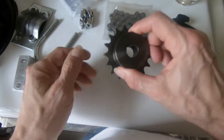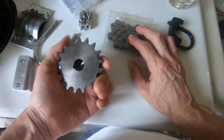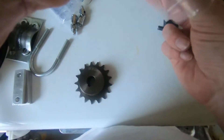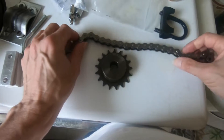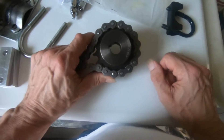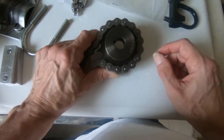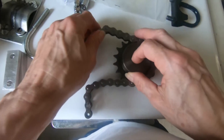I'm going to talk about a couple of them right now. The biggest thing was when I test fit the motor and went to check my chain length for the 17-tooth sprocket. I had to temporarily assemble the whole thing and put it on the bike to test the fit, and what I discovered is that the chain was really close to the tire — way too close for comfort. I just didn't know what I was going to do about it.